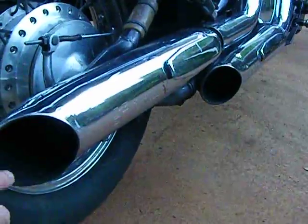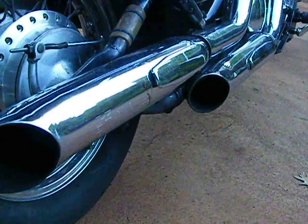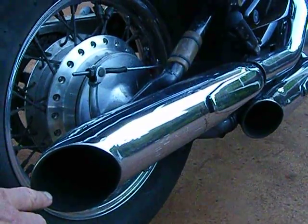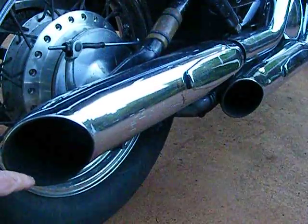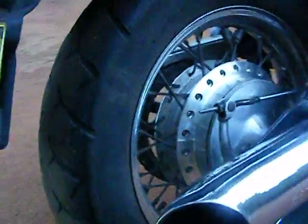When you get up near here, I think it was around this area here, it gets a bit tight for the jigsaw when you come both ways. So then I just used an older chisel that was fairly sharp and just took off the last little bit. Used a ball peen hammer and just knocked the little edges back in so it all looks fairly tidy. So that was the debaffling exercise I went through.